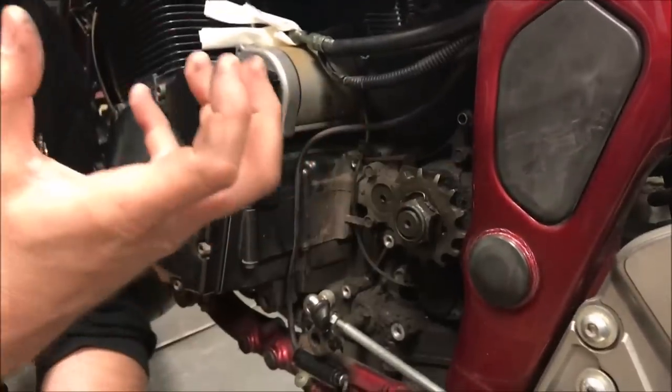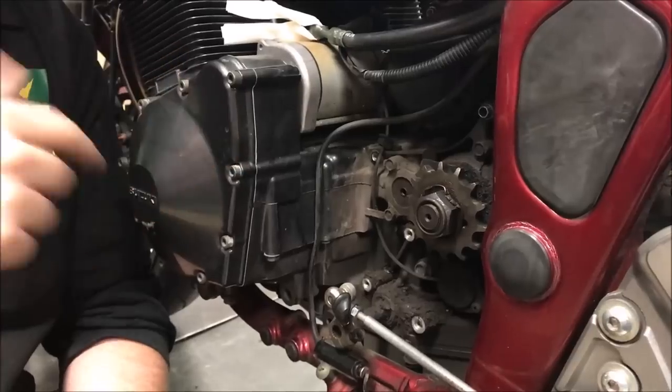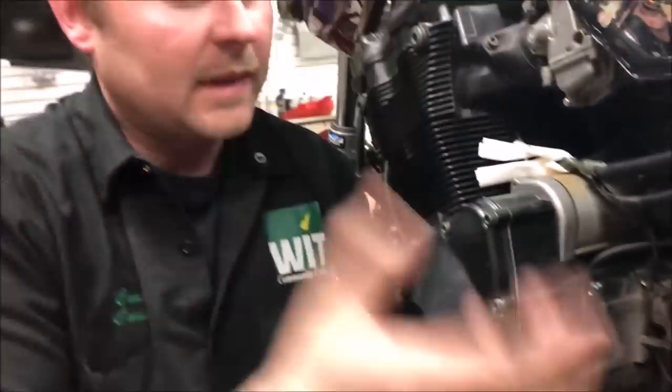I unstaked it, torqued it back, it accepted full torque, torque wrench clicked, and the problem went away. I'm doing major service on that bike again - it's been a year and I'm anxious to check it. I also worked on another Tiger of a different year with basically the same motor, and that customer's sprocket was loose too. It made me wonder - is this more common than we think? With this Bandit here having the same issue, I think we just overlook it. And how many chain and sprockets have I changed without checking this?